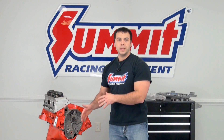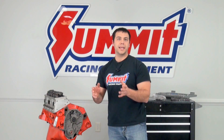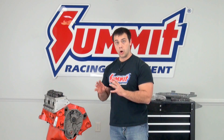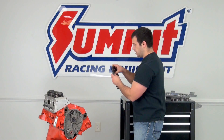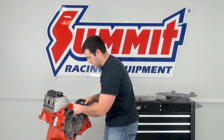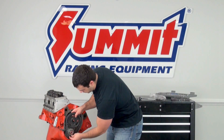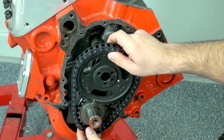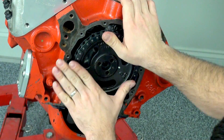For normal builds, generally it's about straight up at zero degrees, but you can go ahead and program that advance or retard already in there. The next step is to go ahead and put the chain around the cam gear, and you start to slowly work that over the crank gear, lining everything up, and going ahead and putting that on the crank.